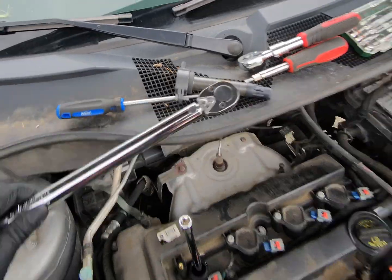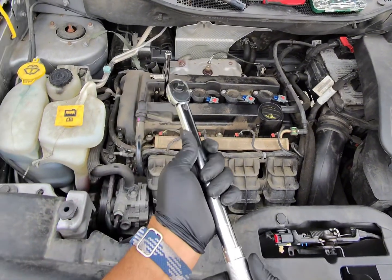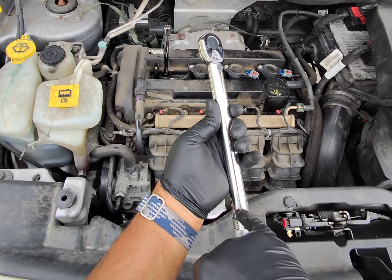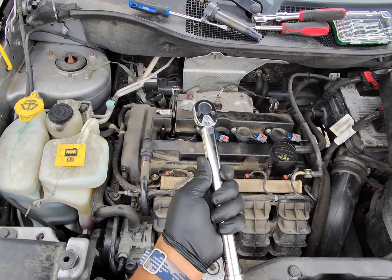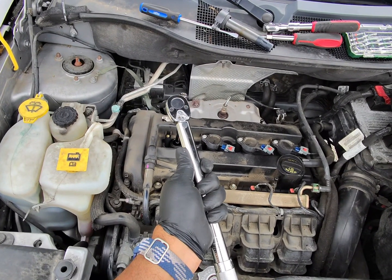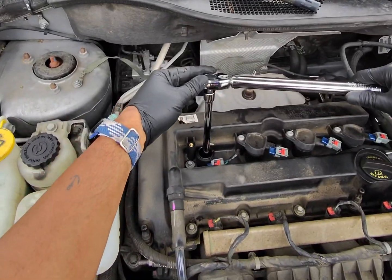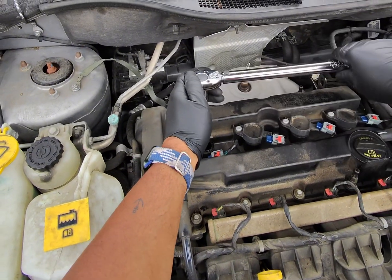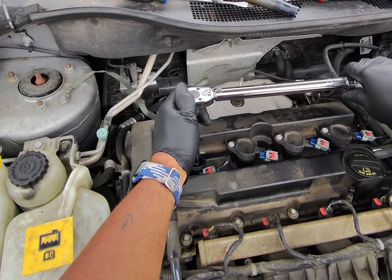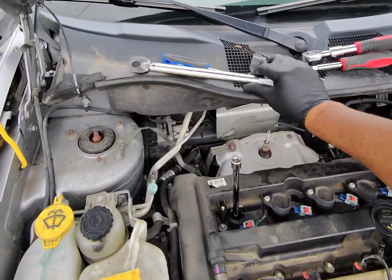Now we'll take our torque wrench. Make sure we're going the right direction with it. Righty tighty, lefty loosey. And back this off. This one is in foot-pounds. The whole numbers and half numbers here, we need 15 pounds. I'm going to take a little bit off because I put that lubricant on the threads. Take it to about a 14. Tighten up the lock. Now we'll come in here slowly, until we hear it click. Right there is 15 pounds. Take our socket off.